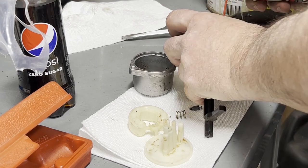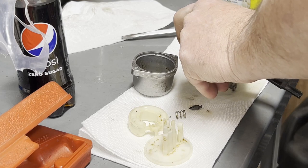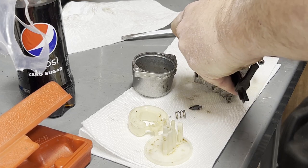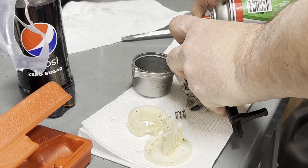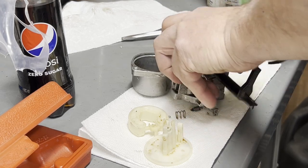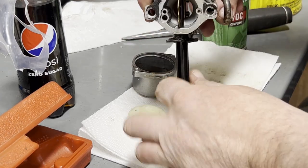that one is a little, there's where the fuel comes in. Ooh, might have been a little blocked. So you just want to hit anything that looks like a jet. This is a small one. So it is coming out of where. I have to blow some air. That one's blocked. So this jet goes through a circuit to this. I didn't realize my hand was blocking it.